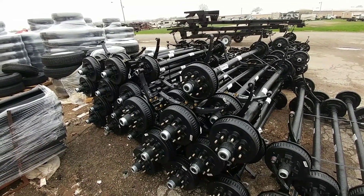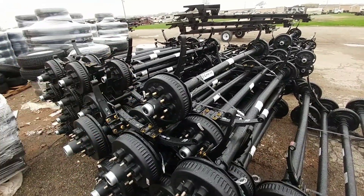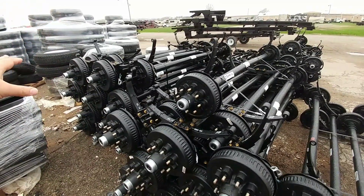They have to make the front of the RV relatively heavy. When they manufacture these products, they make sure that a significant amount of weight is over the front of the fifth wheel where it attaches to the tow vehicle. When we prototype and weigh our units, CSA guidelines call for staying within 15–25 percent hitch weight, but we strive to be in that 19 to 21 percent range — we've defined our own parameters a little bit tighter. We believe a fifth wheel should be a little bit heavier on the hitch.